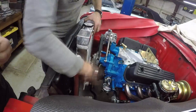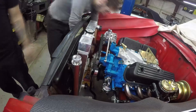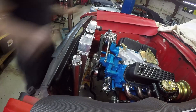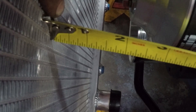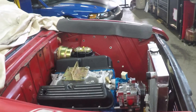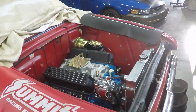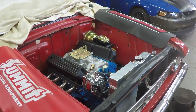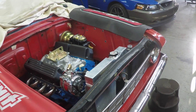I really didn't want to have to put pusher fans on here. But we've got to go from the other side of the radiator, we've got to go in the front. And we can't have a big pusher fan in the front because we have a bracer there behind the grill. So what Bruce suggested — and it was a very good suggestion — is you can put twin seven fans in the front. And that keeps it Ford-ish, because the AC Cobras had twin sevens, twin seven pushers in the front. That wouldn't look too bad — you look through the grill, you see two tiny fans in there. It'll be very Cobra-esque.